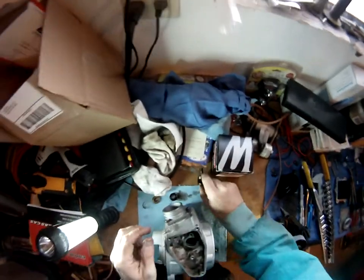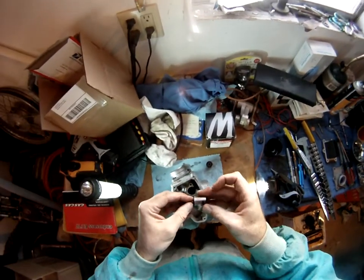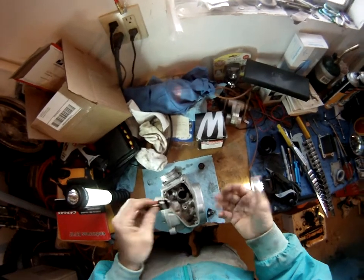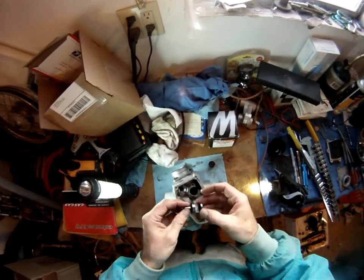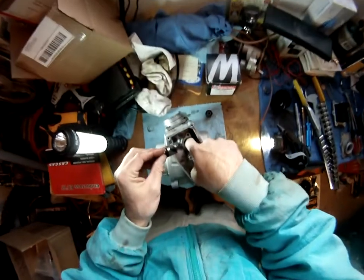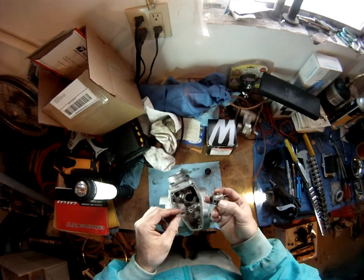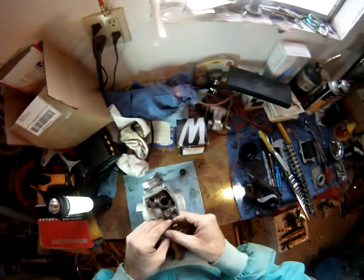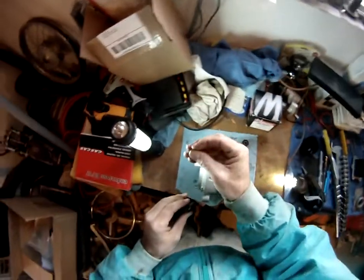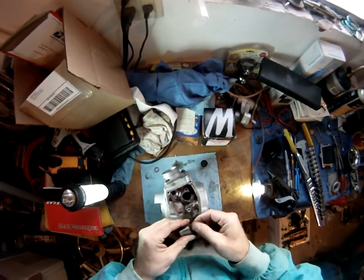Now as far as the left side power valve assembly goes - I'd done that washer mod that one guy talked about in one of the videos, where you put a washer right here below the bearings and it drives it in a little further, keeps the power valve from rattling side to side. And I was reassembling it a few minutes ago just as a trial and I actually bound this one in too far against the power valve flapper, and the flapper wouldn't even move. So I'm a little worried about that happening again, so I'm probably just gonna leave it without the washer. If it continues to rattle I might put a little bit thinner washer in - this is the one I took out, it's not super thick, so maybe I'll find a thinner one to hopefully get rid of some of that side-to-side play and rattle.